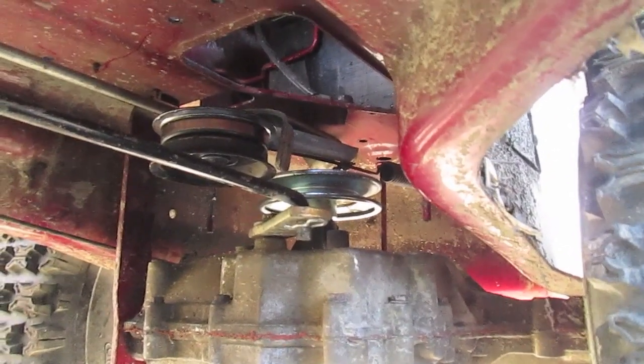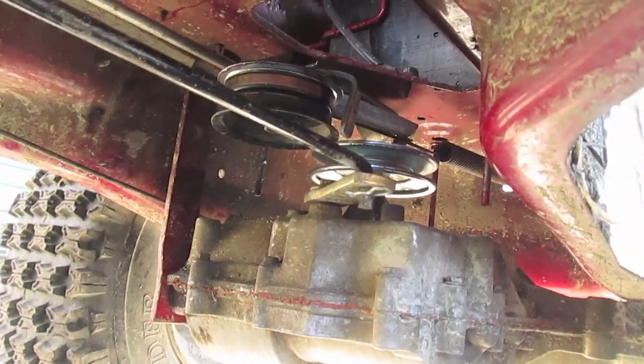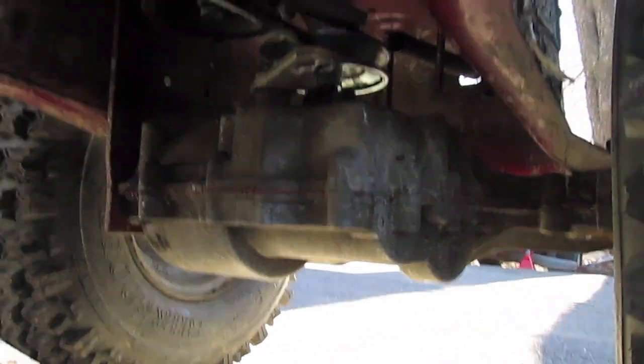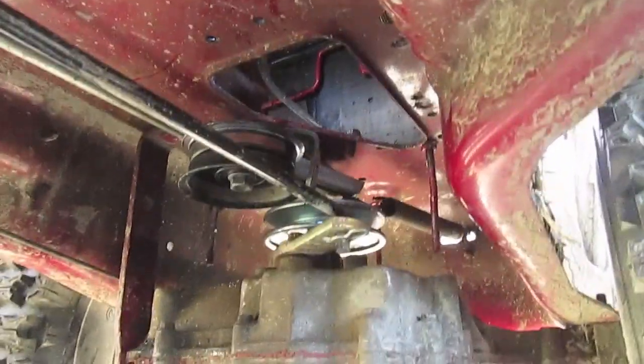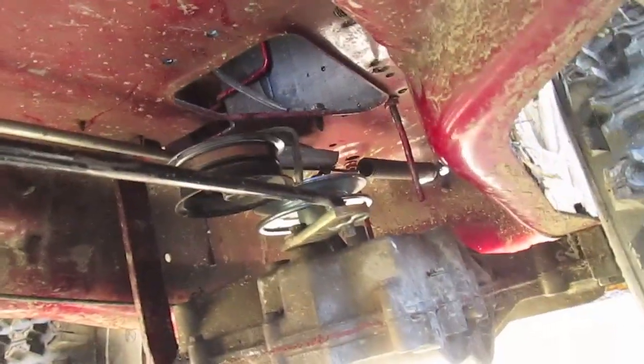I think I might have a little bit of an issue with the belt guards in the rear since it is such a small pulley. I'm not sure how I'm going to do that — I think I'll have to come in from the sides, and I might have Todd help me with it. I might be able to move one over enough and have enough metal to bolt it in. I also need to make an idler pulley for adjustment, because with the smaller pulleys the belt rubs on the clutch pulley. It's also been rubbing on the shift linkage, so I'll have to do some adjustments there.